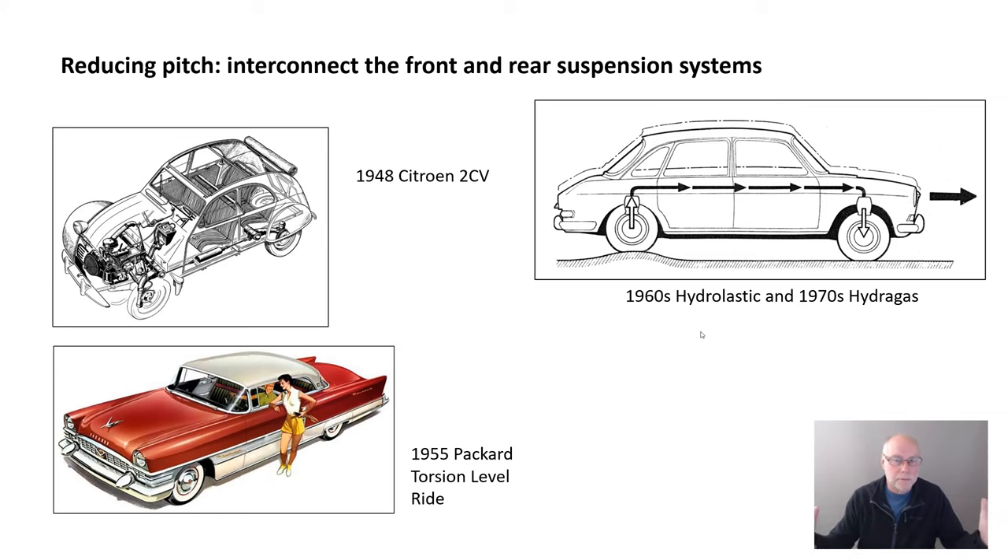Look at cars. Feel the cars when you ride in them. It can be confused for being under-damped, because it feels like the back's going like this — but the front's going down as the back's going up. It's not under-damped; it just has the wrong relationship between front and rear natural frequencies. It's all covered in my book — it's the first book ever written on the history of car suspension. In it I cover a whole range of these sorts of cars and all of those people I have mentioned. You can learn a huge amount by looking at what was successful in the past, what is successful today — because I go right up to current cars — and what's been forgotten over that 120 years. The book is out now, available from Amazon in your country. Thank you.